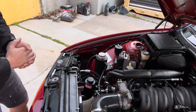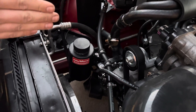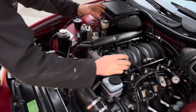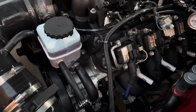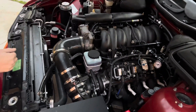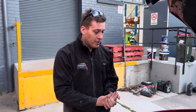What else was the engineer looking for? He wanted a coolant overflow bottle, which I've mounted. Just tried to do standard radiator lines. All the wires just had to be cable tied — it looks a little bit ugly but that's it. All the standard emission stuff: we've got a factory MAP sensor in the back. I've got upgraded coils and leads, but just make sure your engine's in good health because it does have to pass that emissions test.